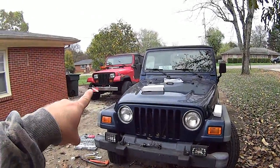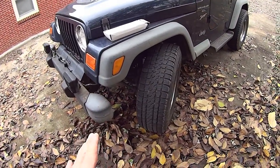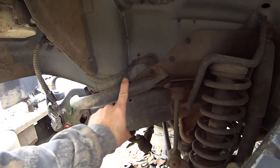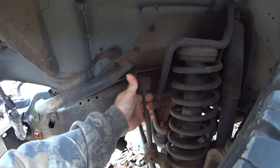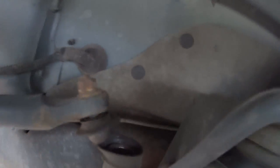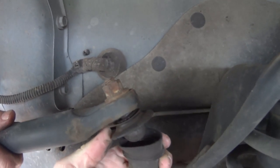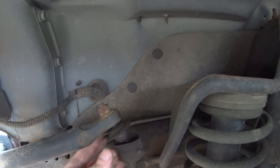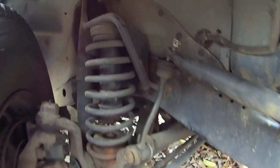Your end links are going to be located right here. You can take your wheels off — totally not necessary. Turn your tire outward. Here's your sway bar, here's where it ties to your front axle, and here is the end link. You can see this right here is totally separated. There was a lot of rattling going on down the road; we couldn't figure out where it was coming from. So we stood up on the bumper, jumped up and down, heard 'thump thump thump' — one person jumping, the other eyeballing — and we figured out this thing is separated. This is what we're changing out today.